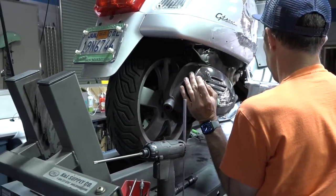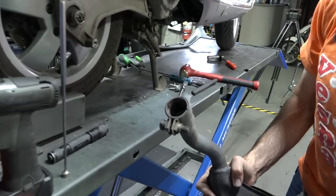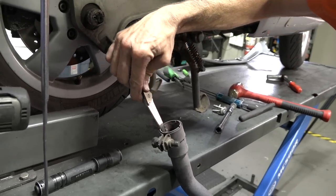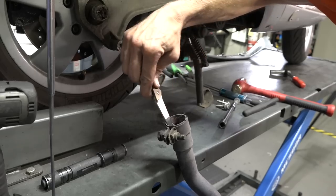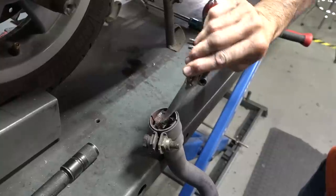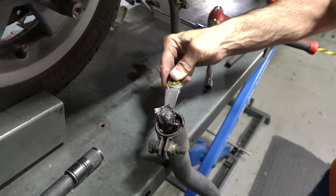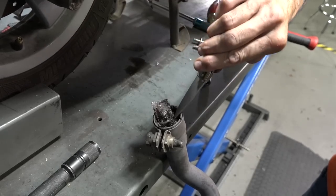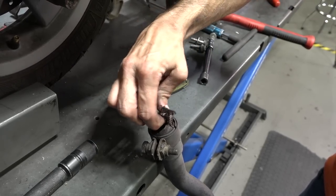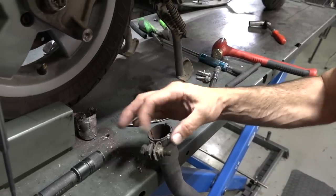I feel a little problem. Let's look at the exhaust gasket — it's in pretty bad shape. There's not much left of it; it's just burned up. Somebody reused it. Unfortunately they don't get that much life and they've degraded to just the metal mesh that's in them — just having an exhaust leak, and that's all there is to it. This bike only has 6,000 miles on it, but somebody changed the tire and probably didn't put much care into it. The newer original Piaggio ones are made to better quality and get a little more life. Here in the service department, we usually just change them every time. That definitely needs to be replaced.